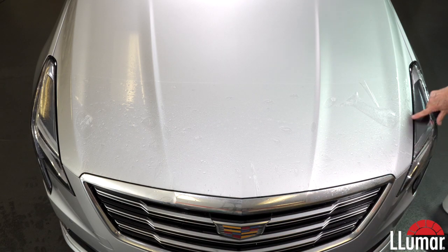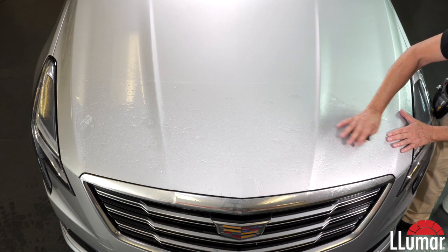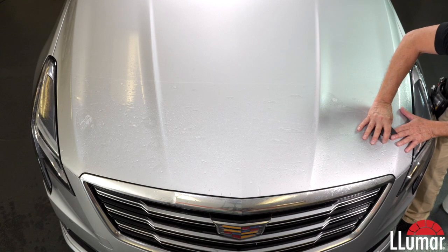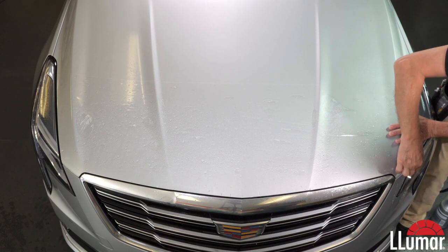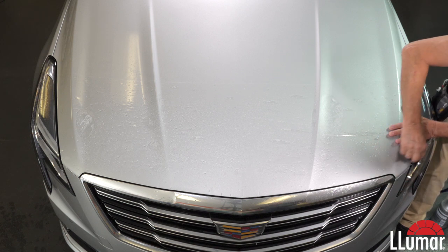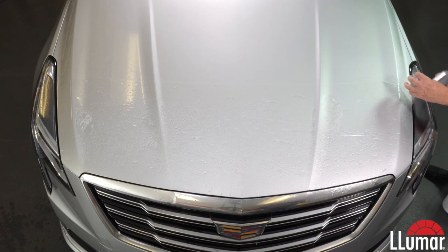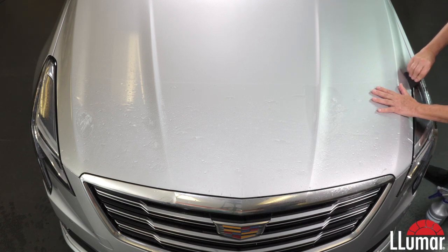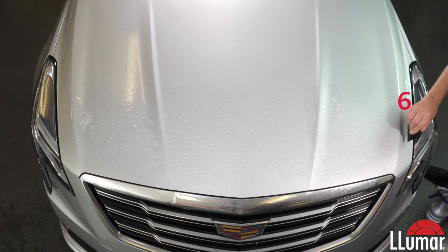As you can see, we do have a pretty nice gap here, which helps us to install our pattern by stretching. Gets most of the fingers out, and our tack point number 4 is here, number 5 is in the back, number 6 is here. Just a repeat of the other side on this side. So our point, lining that up, this and this, same as the other side. Locked in place. And then let's move to point number 5, which is opposite of number 3 on the other side. Bring our edge over nicely. Lock it in place. And then just proceed to finish out the middle area.